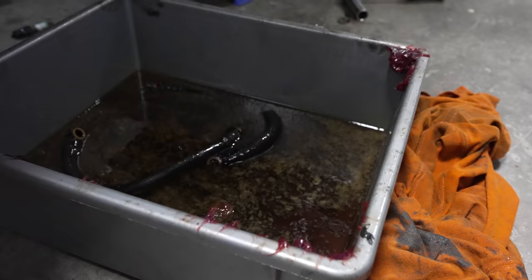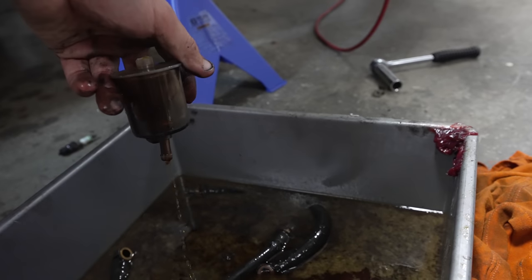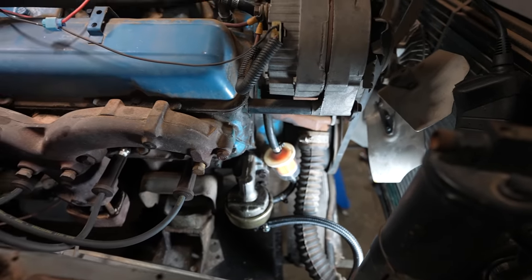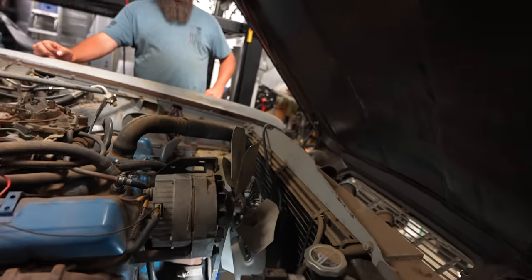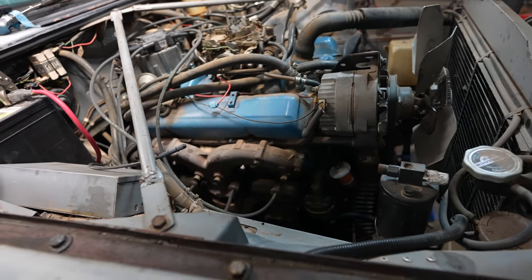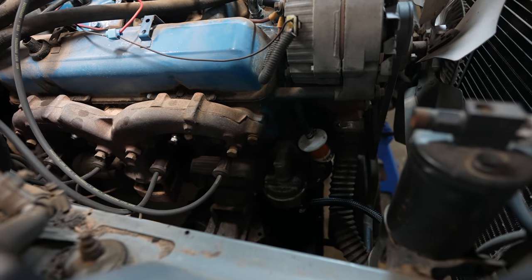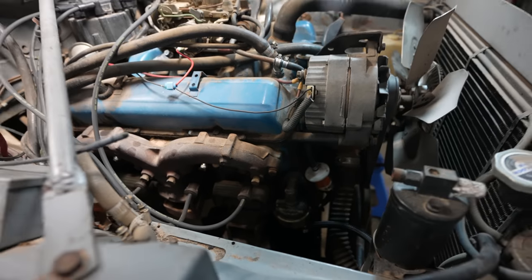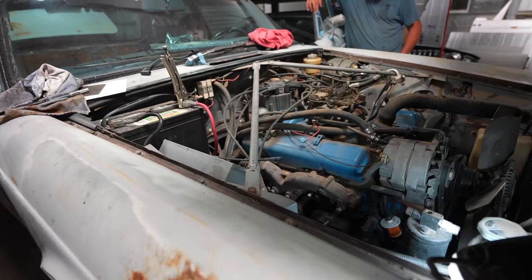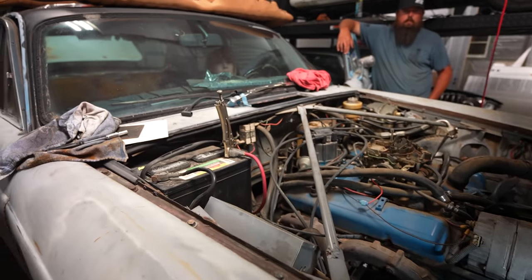Check this out - that's supposed to be fuel. Nasty. Just go ahead and crank it and we'll see if we get some fuel in the fuel filter. Hold on - it might be smart to remove the light first. Small mishap. All right, let's try that again. It's pushing some fuel up into it. It's definitely not filled it up yet by any means. Getting rid of the pumps - we're starting to get some fuel through there. It still looks kind of dirty from what was in the pump but we're starting to get there.